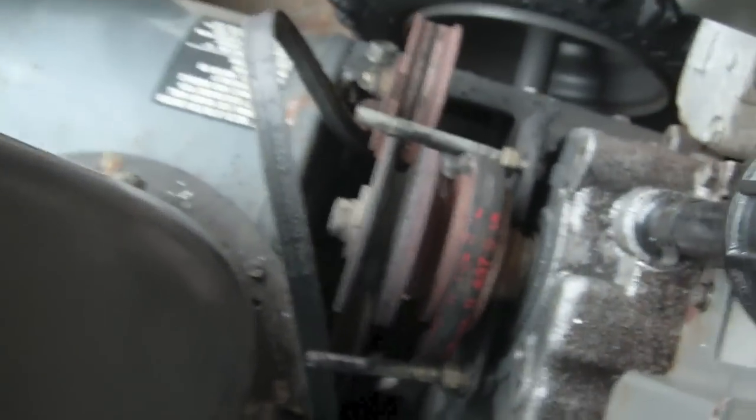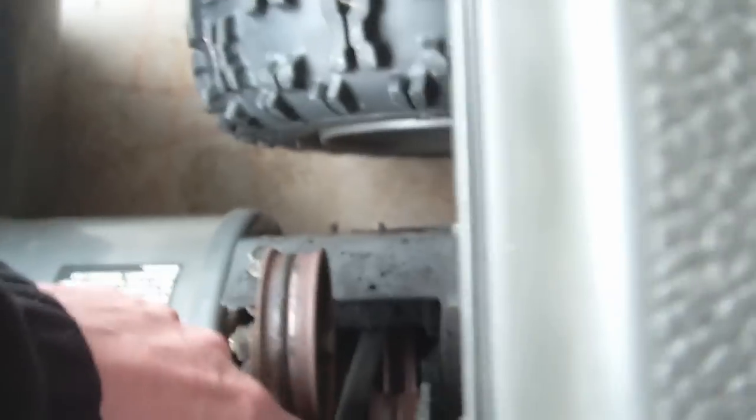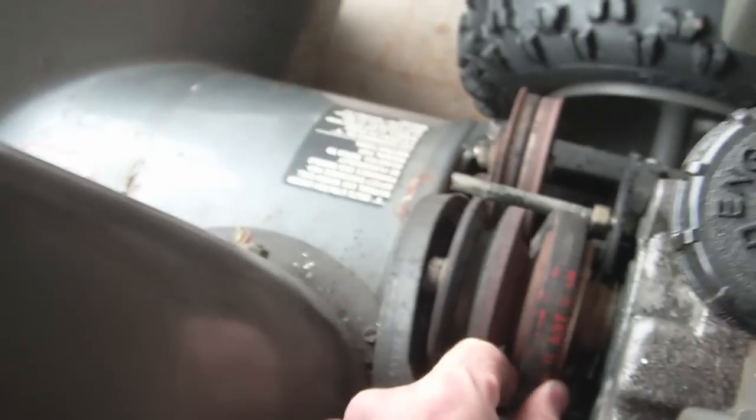I'll give myself a little more light — open the garage door here. It's not too cold out. You should be able to see the two bolts and the belts now. This is all down in front. I've loosened it off. I had to take this belt over here off from the tensioner. I would suggest, if you're going to do this, replace both belts — you don't want to go in here twice.